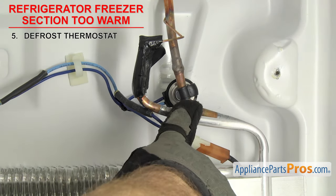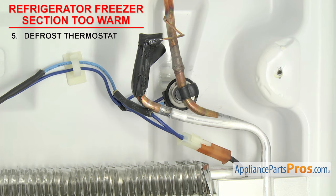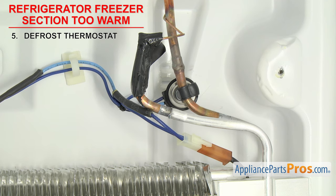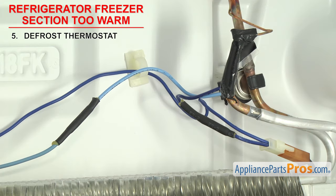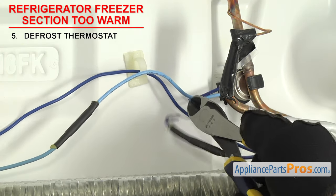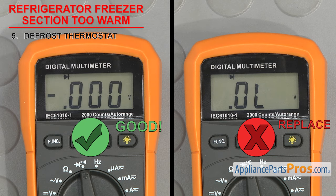The thermostats are usually mounted behind the back wall of the freezer section on the evaporator. If the freezer section is too warm, it could be that the thermostat has failed and power isn't being sent to the heater. When this happens, the evaporator freezes up and cold air can't be circulated properly. To test it, first make sure the thermostat is colder than the reset temperature — it's best to test it in the freezer at around 0 degrees Fahrenheit. Set your meter to continuity. Depending on your design, you may just have to unplug the wiring harness and touch a probe to each terminal, or cut the wires to remove the thermostat from the system. If the thermostat has continuity when it's cold, it's fine and you can splice and seal it back in. If it doesn't, it's failed and needs to be replaced.